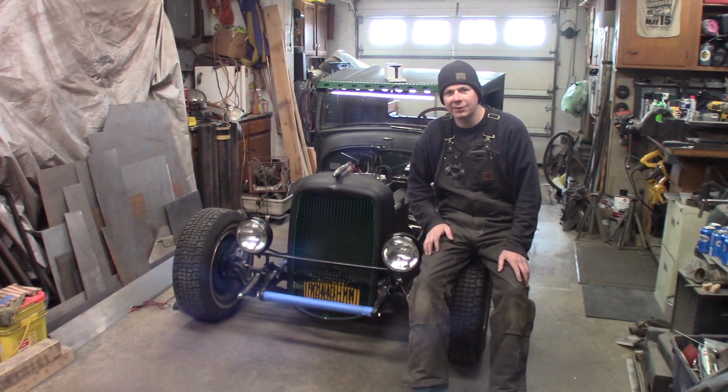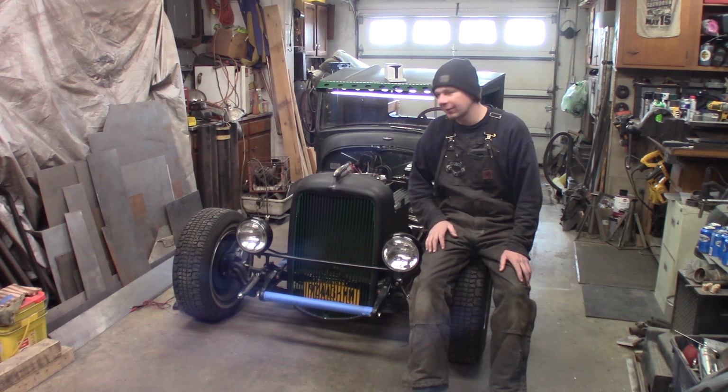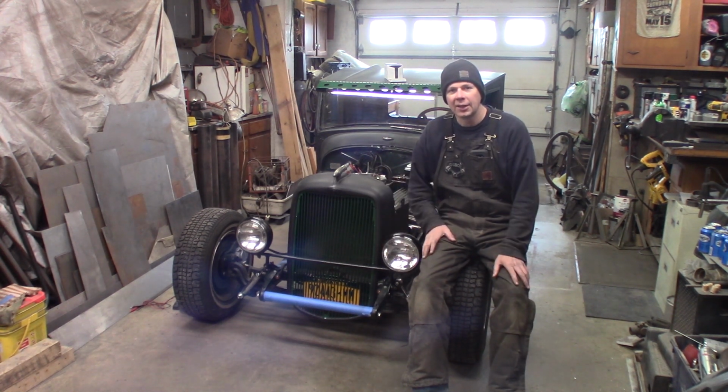Just did a little diagnosing here in this video, but everything else is pretty much ready to rock and roll in this truck. I've got it registered, it's got temporary inspection, I've driven it a couple miles. I also need to look into fixing the speedometer. The speedometer reads way fast for the speed I'm going, so we're going to change the speedometer gear. I'm going to have to calculate which one I need to run.